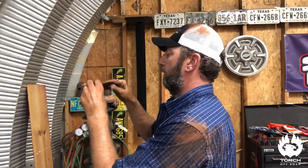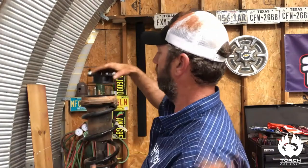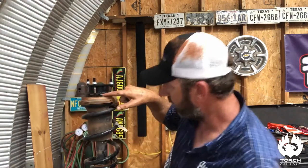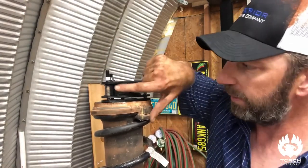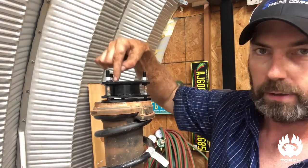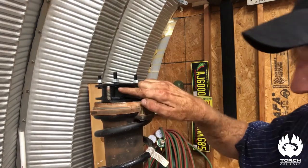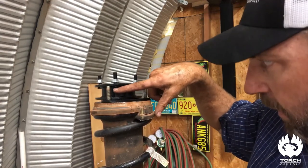This goes right in the same spot so you don't have to worry about tweaking anything on the bottom of the strut. You put your plate in here and set this spacer on. The reason we're doing that while it's off the hole is because we're going to have to trim this stud a little bit on the original part of the strut. That way when you put it on, your new strut isn't sitting up in the air — something would end up breaking. You can see the gap right here; that's because your original studs are hitting on our new spacer. Pull it out of the holes and set it next to it, then look at where the bottom of the stud presses in and make a mark.